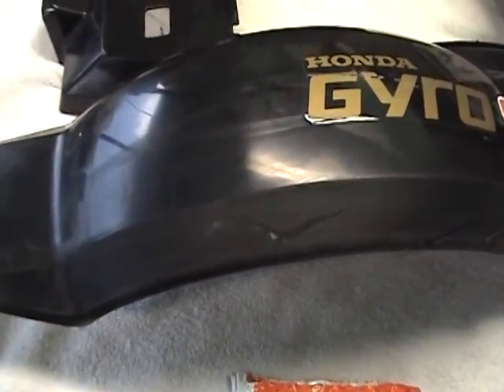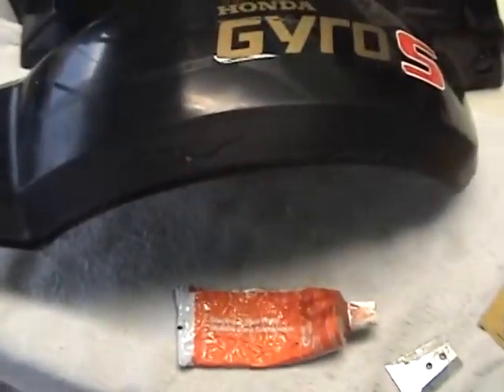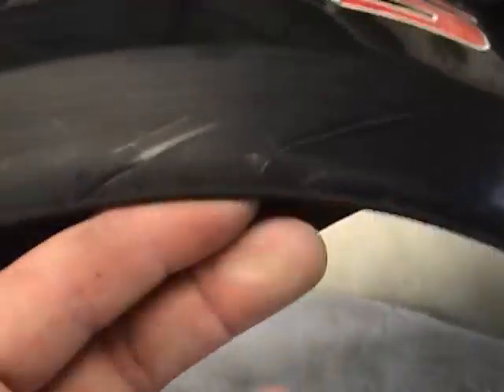What we want to do is find the low spots, like right here. You can see where there's a rip along here. What's happened is this bike has been put away somewhere and something has scratched it. We want to fill in this scratch with putty, along with these scratches here and these other little scratches along the bottom.